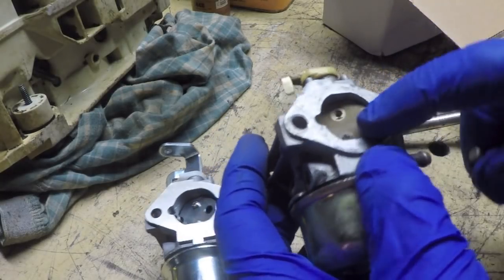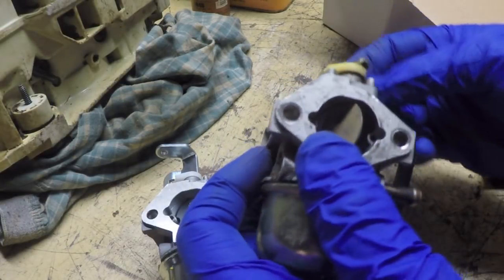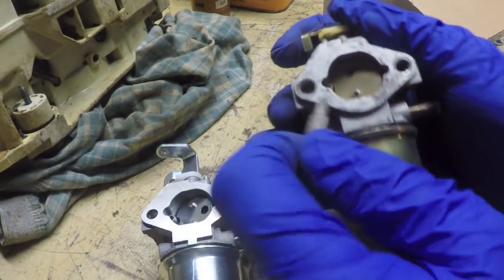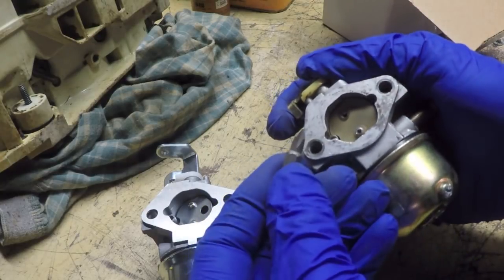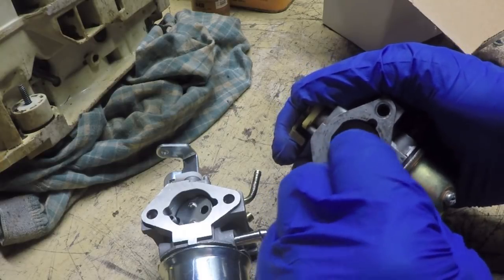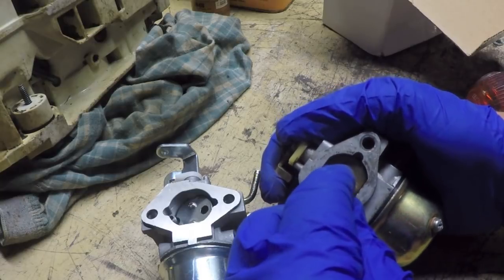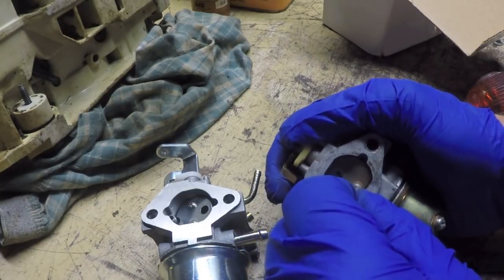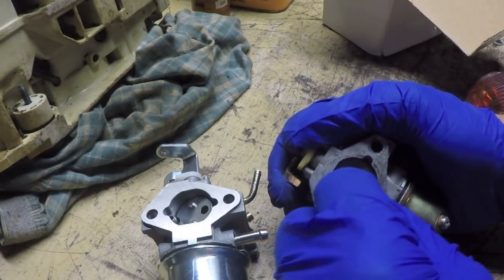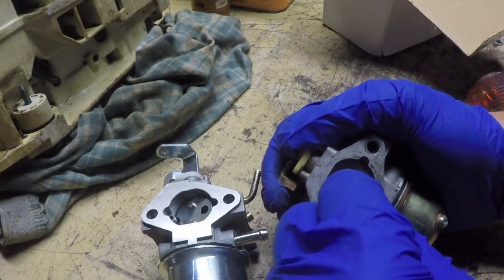Well, I got one of the two screws out, and the other one, unfortunately, is starting to strip out. One bit of advice: these screws, when they get stuck in there, they could be a bear to deal with. Try several different screwdrivers for fit. Make sure you get a feel for it and see if it's camming out ahead of time, and then put a lot of pressure on it when you're trying to turn it. The trick is to kind of feel when it's not going to happen and give up right away. Unfortunately, I pushed the issue and I kind of stripped out this one.